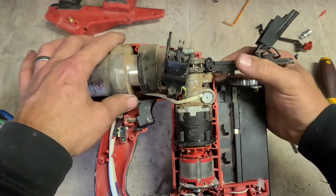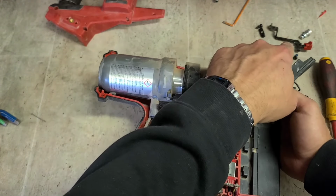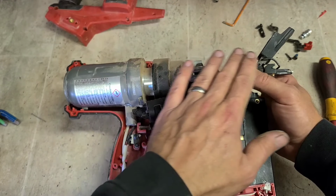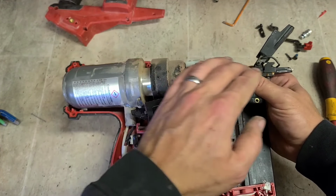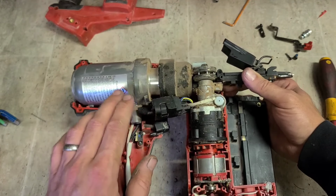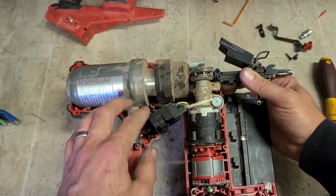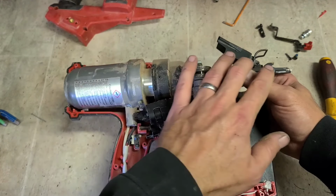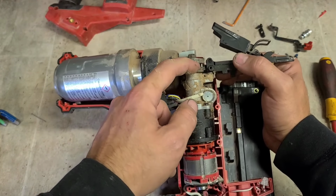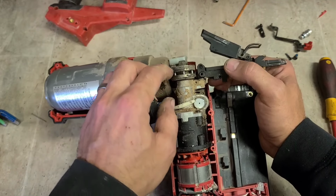And everything then up in the head itself, the actual chamber, not including the wee plunger. Everything else, if I just take off this motor assembly, the entire head up here, chamber, pin, even the door, that's all one piece. Can't buy any of that separately. Pin brakes, can't replace it. Your door brakes, you can't replace it. It's about €300 for that part. But it's handy you can get these pins because they do sometimes wear out. And if you replace them before they fail completely, you do save your pin.